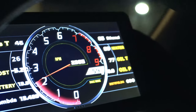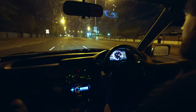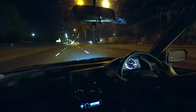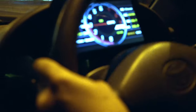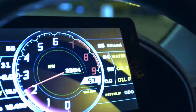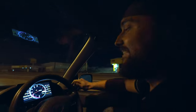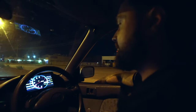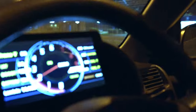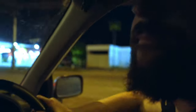88 degrees — we'll see what it gets to. Just going to do a roll race. Fries the tires — water temp went to 97 and we're already climbing down — 95, 94. The wheel spin on this is ridiculous. To explain what the water temperature usually does: it'll skyrocket to 110 and just stay there. But now it's sitting at 93 and coming down. Well, that looks like a big win. I'm happy with that.